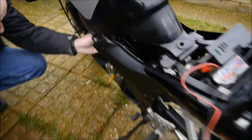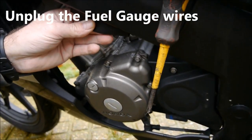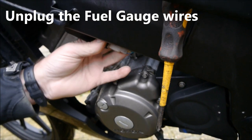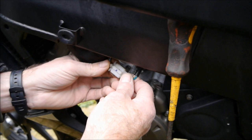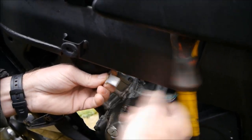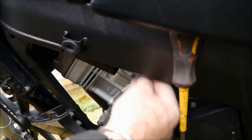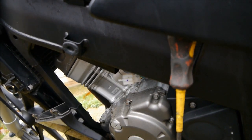In here there's a little rubber cover — slide that up and you'll find lots of wires. You need to disconnect this one here, because that's your fuel gauge sender from the tank. That lead stays attached to the tank, so as we lift the tank, that comes up out of the way.